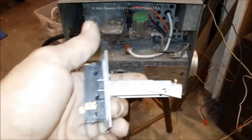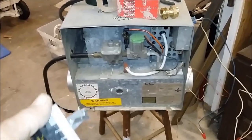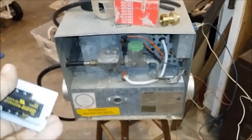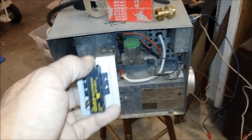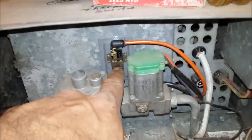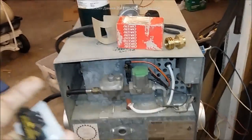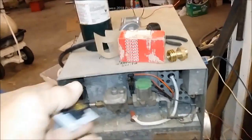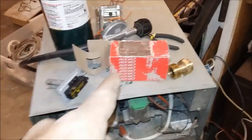This is designed as a safety feature so that it closes and shuts off the gas, allows it to continue to blow air. So you might have an RV where the blower's running but it's not very hot, and then in a few minutes all of a sudden it'll start coming out hot again with the blower still running. That's what it's doing — it is switching the gas on and off to keep the air temperature, because this goes up inside the air handler and keeps the air temperature at a certain rate so that plastic tubing or dryer vent-type tube running through your RV doesn't overheat and cause damage.